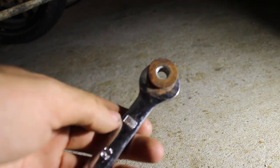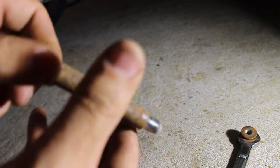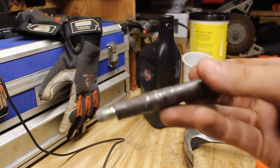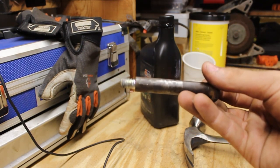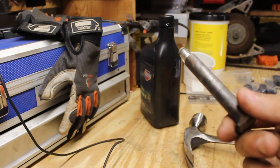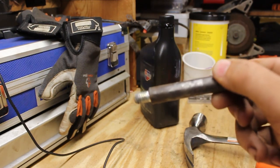Okay, I got it off. That was actually a little bit harder than I thought, because the battery tray is blocking off your access to everything. There's the bolt — of course it has the sleeve rusted onto it. I cannot get this thing off, so I'm going to have to just reuse it and put it back in the bushing. Don't want to break the bolt, so we're just going to reuse this.